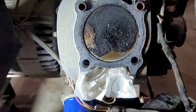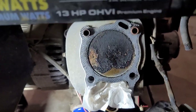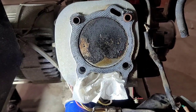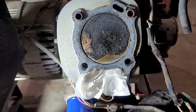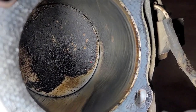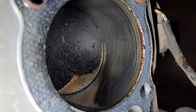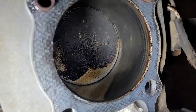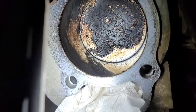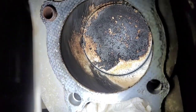Here's the top of the piston — you can see where it's been burning quite a bit of oil. But if we rotate the engine and look at the sidewalls, we're in pretty good shape because I can still see the original cross-hatching. There are no vertical scratches, which is a very good thing. So the block of the engine looks to still be in good shape — it just needs a very good cleanup.